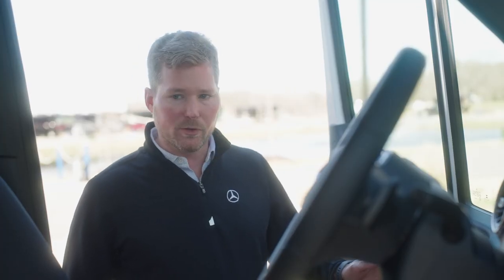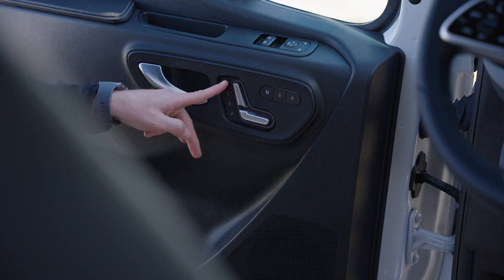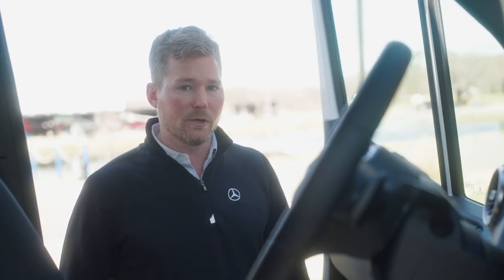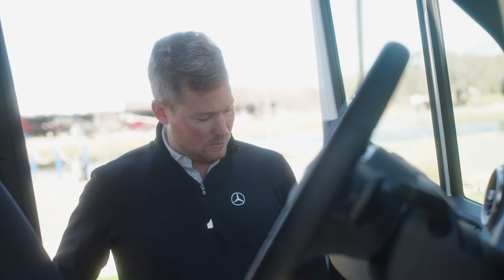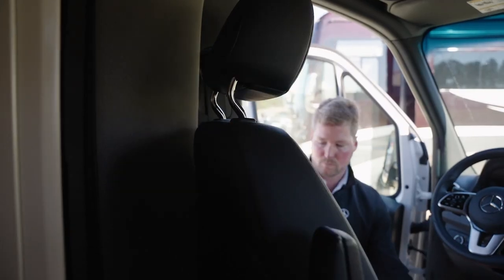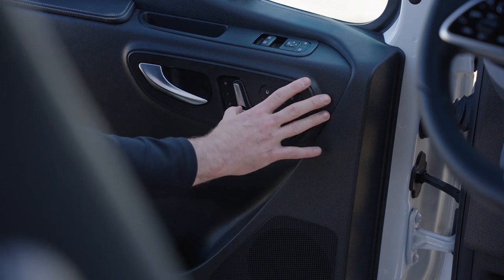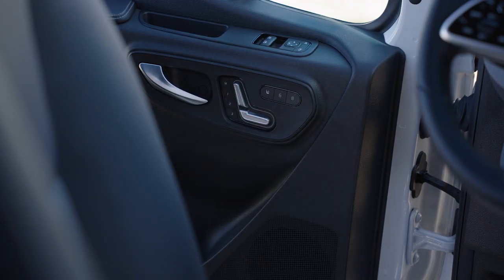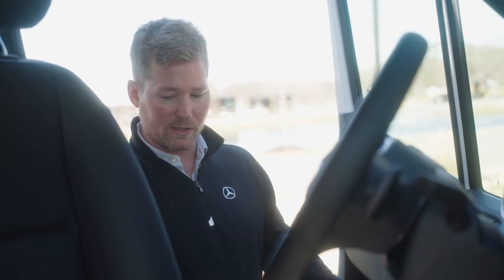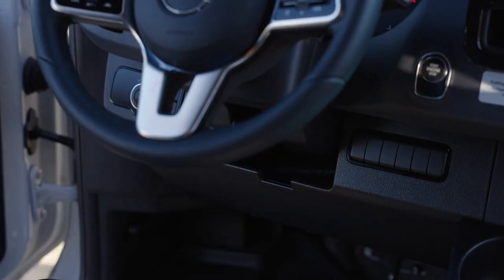We're going to save your seat position. Come over to the door where your seat adjustments are — you've got M1, 2, 3. To save the first position, simply press M for memory and then press one; you should hear a beep to let you know you've successfully saved your seat. Another tip: you may want to save a third position — the swivel position. If you're going to turn the seat around, you may run into your B-pillar. Get the seat at a good right angle, slide it up just a little bit, and now you'll clear that B-pillar. Press memory and three to save it. When you get out and pull up and get ready to camp, just press three and the seat will be primed to swivel. When the seat is swiveled, launch your steering wheel all the way into the dash to maximize cabin space.